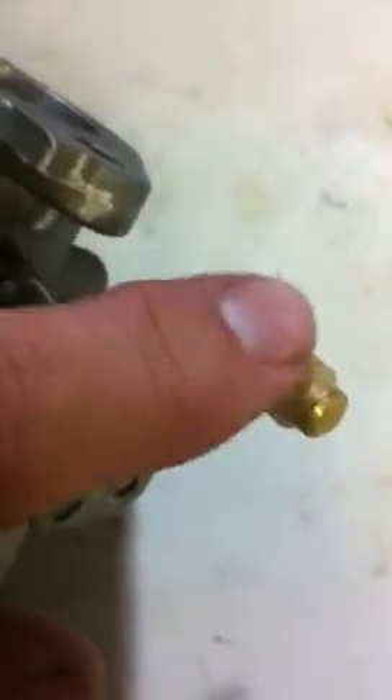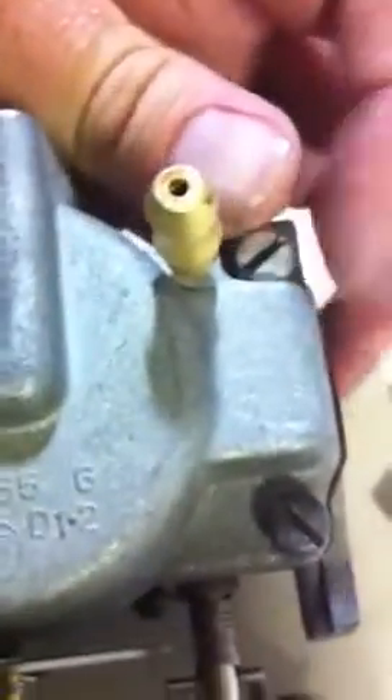While I have this apart, I'll show you — this right here is your cam roller. This one is still good so I'm not replacing it, but a worn cam roller will cause a lot of problems with timing not advancing when it's supposed to. If you have any bad flat spots or if it's worn down really bad, I'd suggest changing it — they're about three dollars. The carburetor kits are around twelve dollars a piece.